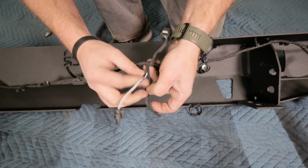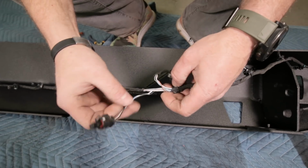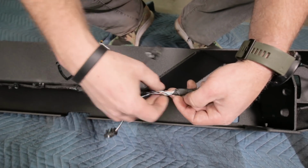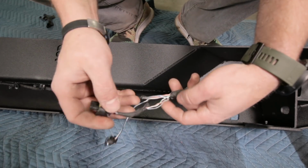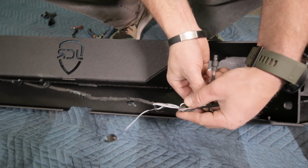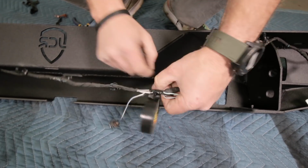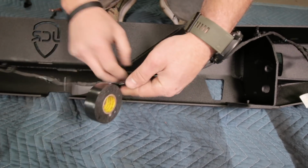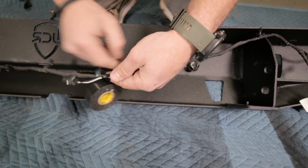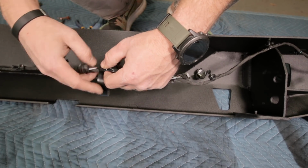All right, so what I did was I unwrapped this license plate light tape right there, and I unwrapped the tape right here just to get me, it's like about an inch or an inch and a half extra wire for this sensor. I'm gonna go ahead and pull that back and then retape up this. And since I don't need this license plate light, it's probably a really great idea to tape this up